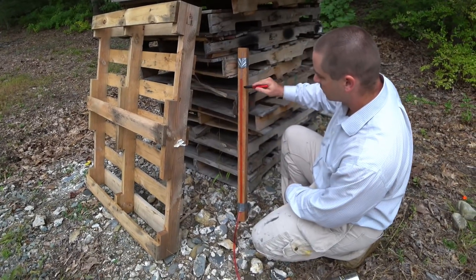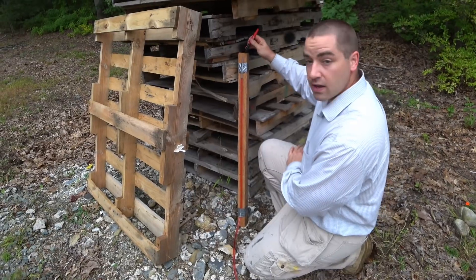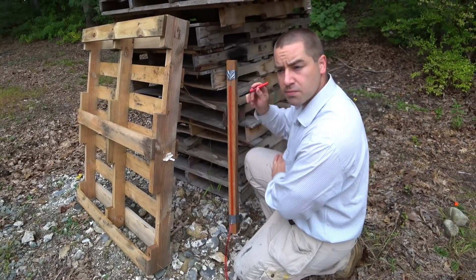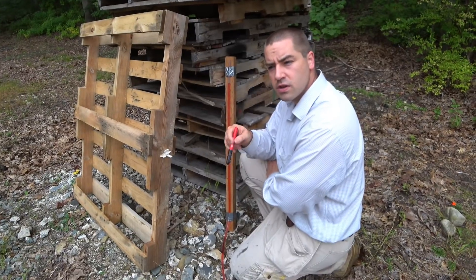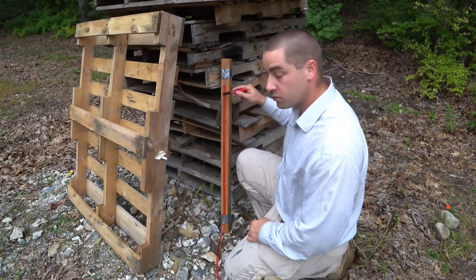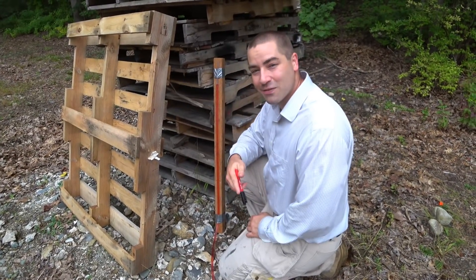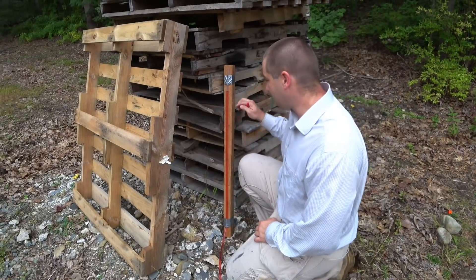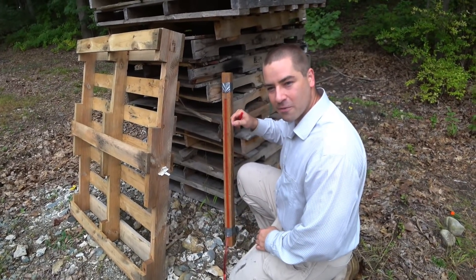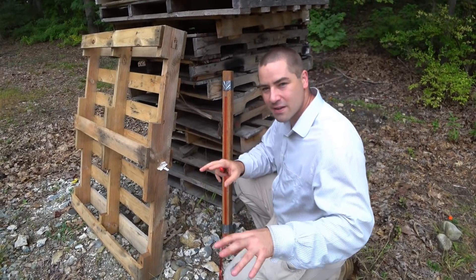Something to note: as I brought the stick down, the water shot way up. If that spills out then you lose your reference because you've lost some of the water in the hose. So you want to make sure that you have extra hose and you're marking down at the bottom. I made that mistake the first time — my mark was way up at the top, and every time I moved the hose around some water spilled out and I wasn't accurate anymore. You've got to make sure you have the same amount of water in there.